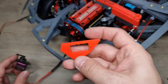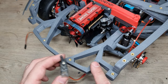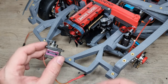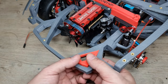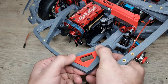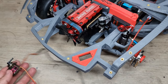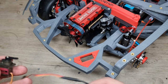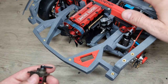For the throttle servo I made this bracket and it goes here. I didn't make any hole for the servo because this chassis will also be used for an electric build so we don't need a servo for the throttle. But I made this and it's a tight fit — you just put it in, and if you use glue even better. I have this servo already extended from a previous project so I will use this, though I don't think you need to extend it because the receiver will be right here.